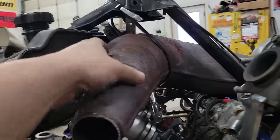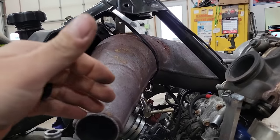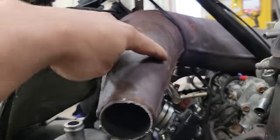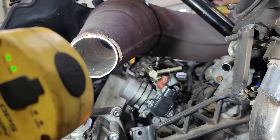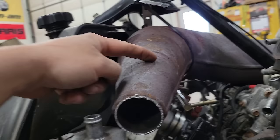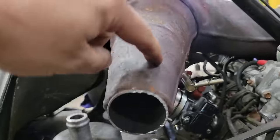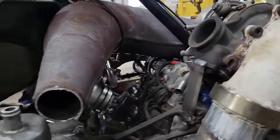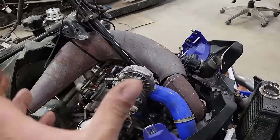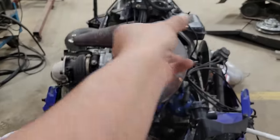Looking at this pipe — it's got this cone, and the whole point of a two-stroke expansion pipe is the cone necks down so you get the scavenging effect from the two-strokes. That's why they neck it down tight at the bottom. This is a two-inch opening. Even though the cone is coming down to the point, it stays that two-inch pipe up into about here. So theoretically I should be able to chop this down to about there and it'll still neck down to two inch on the inside, which will give me more room to do my bend — my twisty, fancy pipe — to connect to the turbo without getting into my side panel.